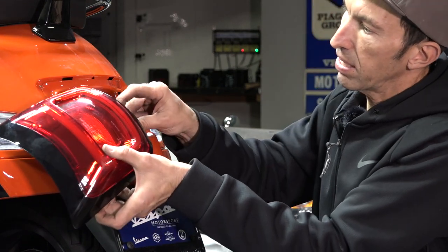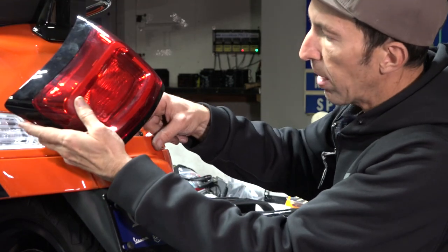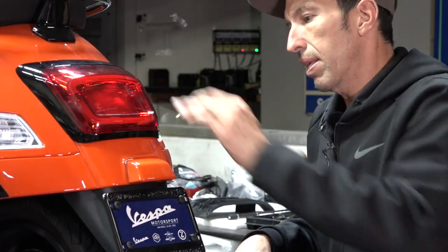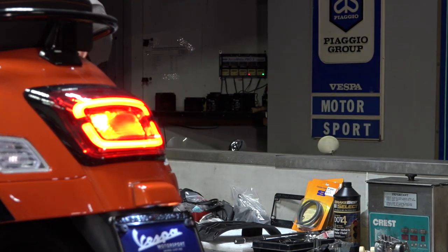Go ahead and get the connector back onto that little tab. Tuck this little module into the pocket where the tail light goes, and make sure the wire doesn't get pinched near that single fastener. That's the install of the brake light modulator on your 2023 Vespa. Don't forget to put the single nut back in to hold the tail light in place and you're all set. Thanks for watching — it's Robot here from Vespa Motorsport and ScooterWest.com. Check out Vespa Motorsport on YouTube for hundreds of how-to videos for all Vespas, whether you want to accessorize a modern one, rebuild a vintage, or service a newer one yourself. See you in the next one!